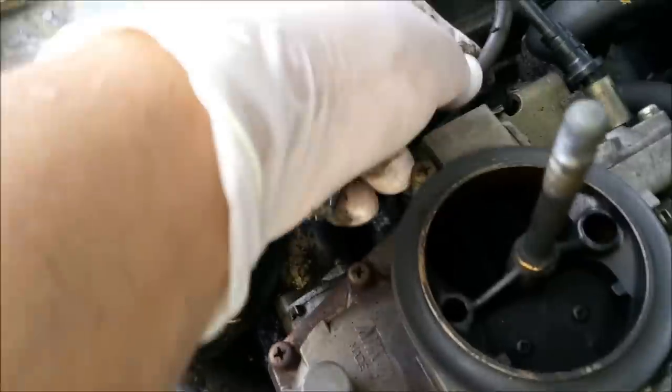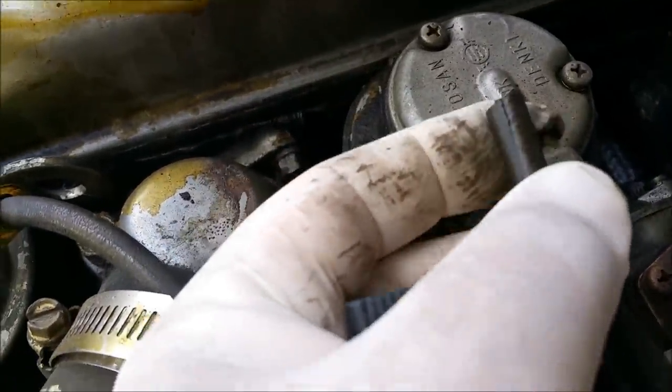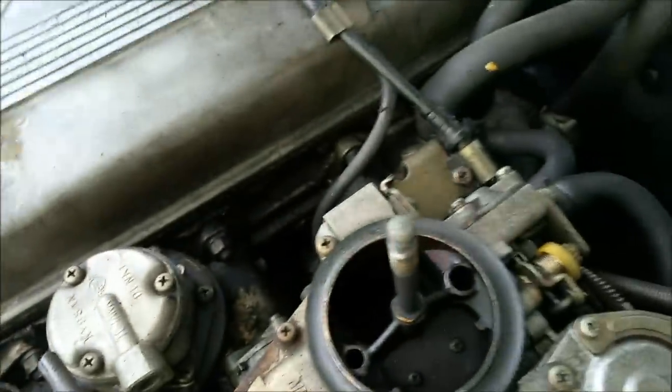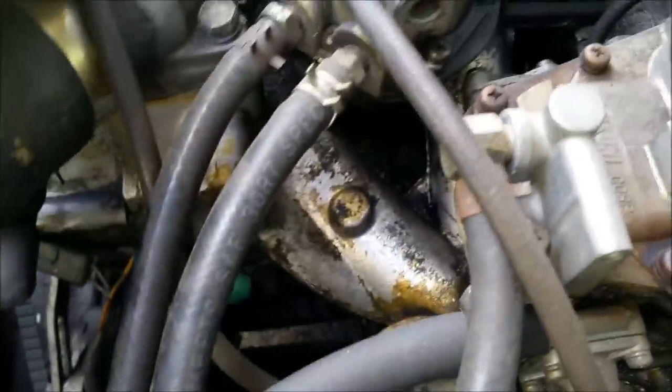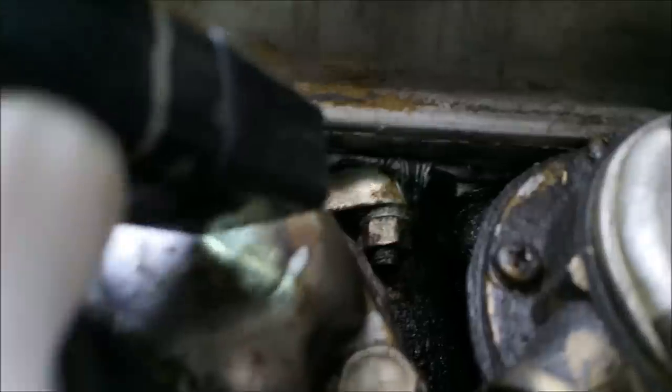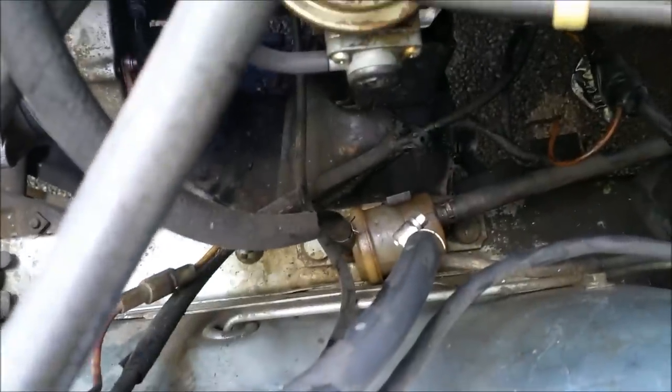Everything to be expected. We've got vacuum lines which are rigid. We've got vacuum lines that are split. There's a heater hose down yonder which is completely oil-soaked. It would be a mistake to put this together without replacing stuff like that. I've got silastic that's pouring out of somewhere - silastic has no place on this. There are better seals around. The fuel filter down there looks dreadful. Generally the engine bay condition might clean up a bit.